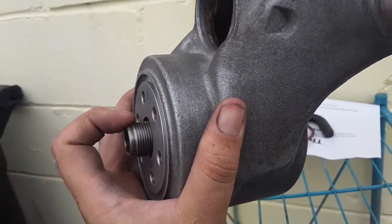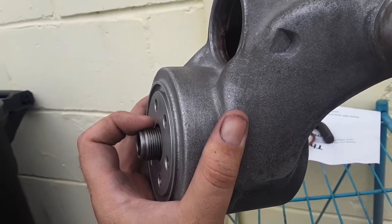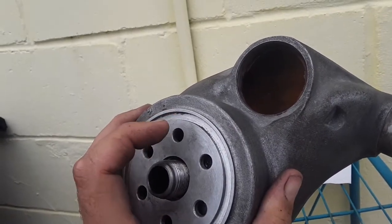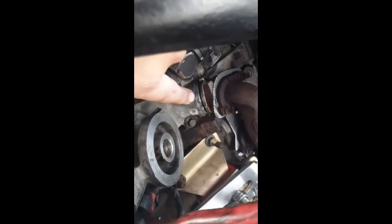Your unit will look like this with a shaft going through it that comes out the back — that's what screws into the oil filter adapter. The other O-ring goes up there, which I'll show you in just a second. The last seal goes right here. This is the filter adapter, that is the water neck, and you can see the groove up here — that's where the oil seal goes, right up there in that groove on the water neck. You can see I have the O-ring installed. That will fit inside that hole and everything will line up.